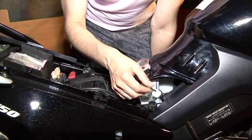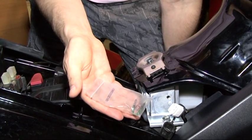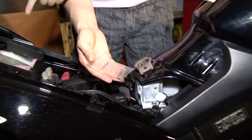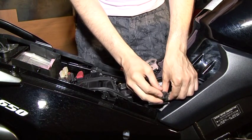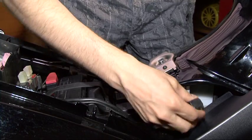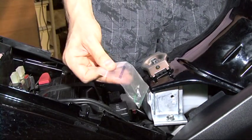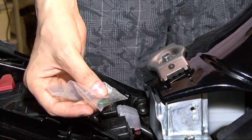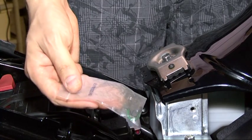Now that we have finished, take off the jumper or the paper clip, put it into a small sealable plastic bag, and keep it under your seat. Put the rubber cap back on so that water does not reach inside, put it back where it was. Always carry either the jumper cable or the paper clip - something conductive that fits there - in a sealed plastic bag like this one, and have it under your seat.